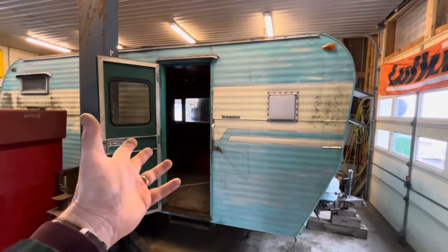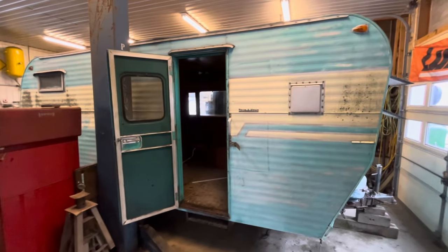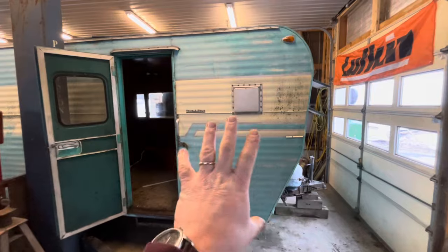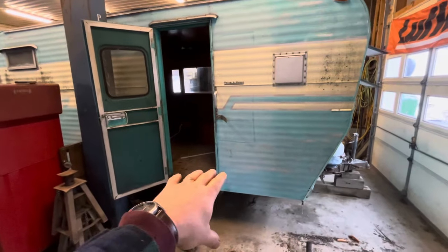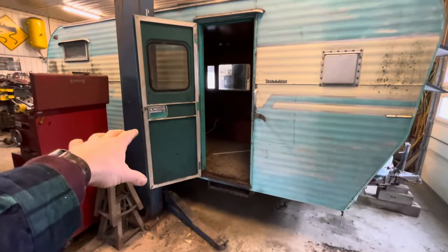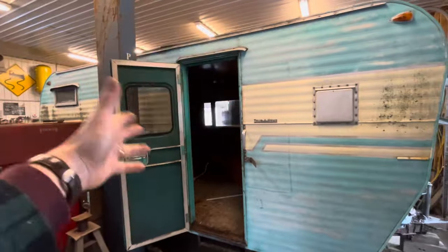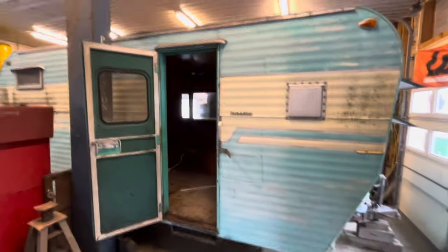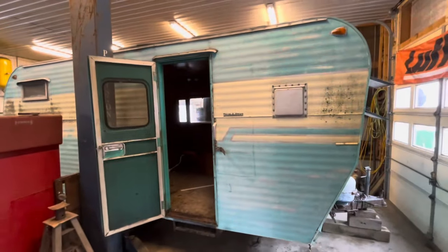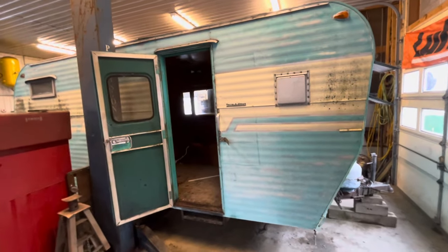When you have one of these old campers that has issues, has been leaking and has rot, the right thing to do is to pull the skins off the outside. The way they build these campers is they build the steel frame, they put the deck on, they put the wooden walls up with the paneling on the inside, and then they frame all the cabinets and things, and that's kind of what holds it together. The very last thing they do is to put on the skins on the side and on the top. So to fix it, you really should go about that the opposite, which would be to pull the skins off first. It's a daunting thing to do,